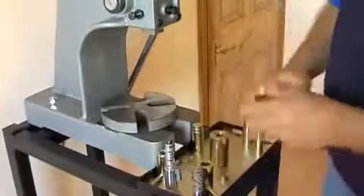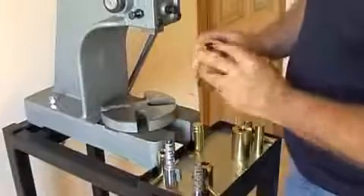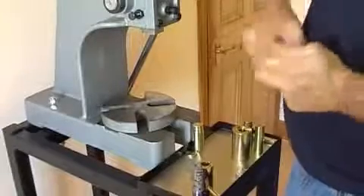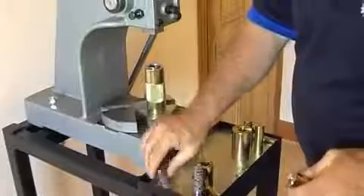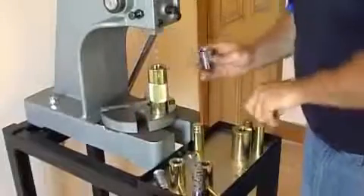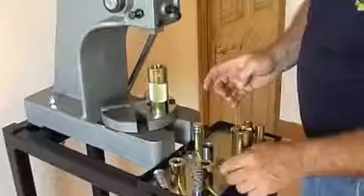Now moving on to the larger of the two solenoids — just turn the fixture over and we concentrate on number two. Again, start with spacer 2A, insert the solenoid, and using the other opening tool, just like the original style, rotate it round. Place the turret for cleaning, remove the solenoid, take it apart. As you can see, it's just the same design as the 5550s and the 6-speed.